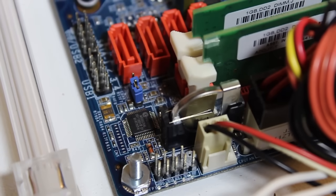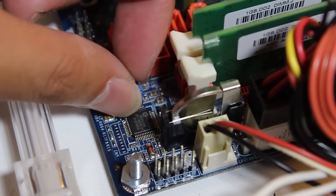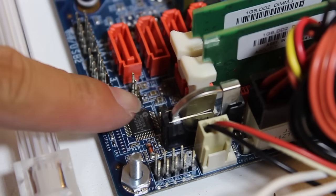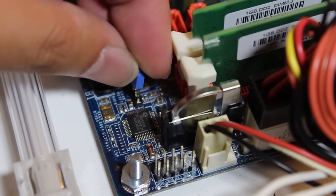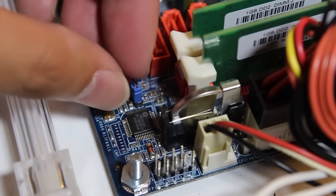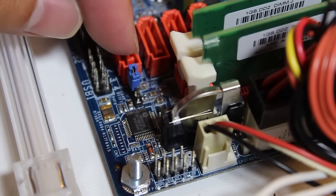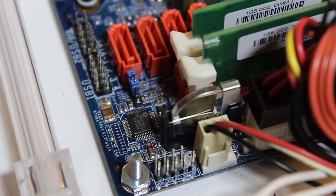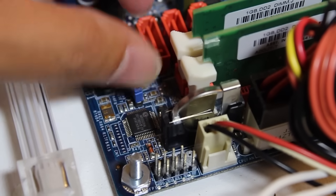Here is an AMD system. I wanted to show you this particular motherboard — not because it's AMD, and not all AMDs are like this, Intel systems can also be like this — but I wanted to show you the example where there are three pins. Basically there's pin one, two, three. When it's not enabled to clear the CMOS, it'll be on the first two pins. And then to clear the CMOS — or enable clearing the CMOS — you put it on the other two pins, and that will essentially clear it. That's just an example of how it could be on your particular motherboard.